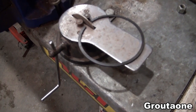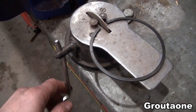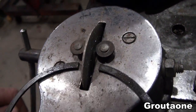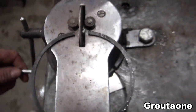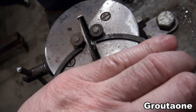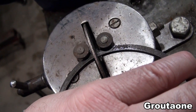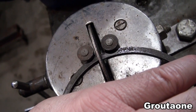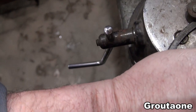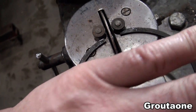If I had a ring gap that was too tight, there is a way to enlarge it with this tool here — it has a grinding disc that grinds from both sides. There are little stops, so you place a piston ring up against those stops, squeeze it against the disc, try to keep it centered, and then turn the grinding disc with the other hand, being very careful not to take too much off.